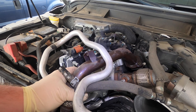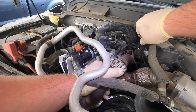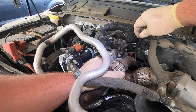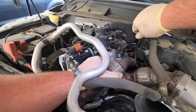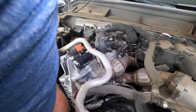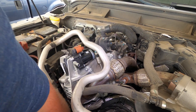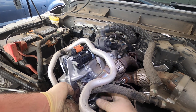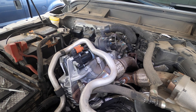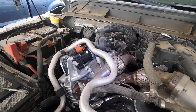We'll drop that gasket in. I'm going to set the one back here in — it's a new gasket. I'm using the same bolts. You can tell they're not the silver bolts, they're more of a brownish color. Spray a little lube on them to give us the best chance. We're going into aluminum, so it shouldn't be too big of a deal — it's not like we're going into cast iron.